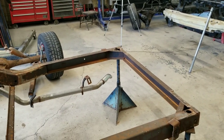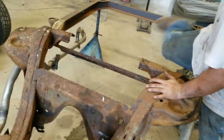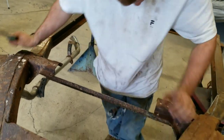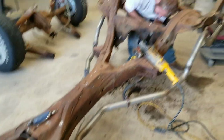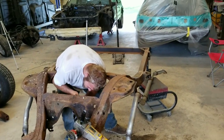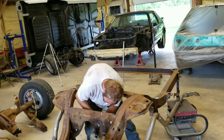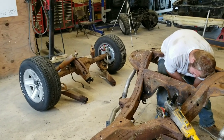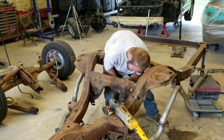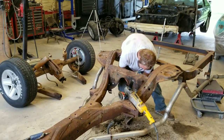It works like a charm - great stuff. It's way cheaper going that route and it's rock hard. You can get gloss black or flat black or whatever. We're just going to keep scraping, grinding, and wire brushing and get it all done up to about here. Then this back section we'll clean it, use the neutralizer on it, and get it POR-15'd. Then it'll be on to the rear end, and hopefully the bushings will be in by then - should be here about four or five days from now.